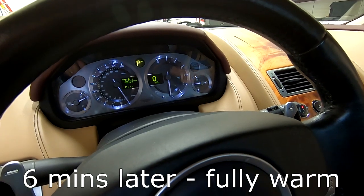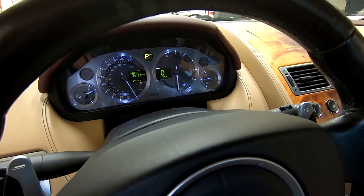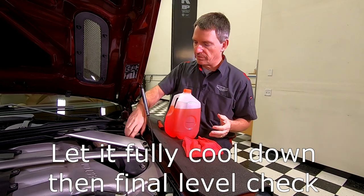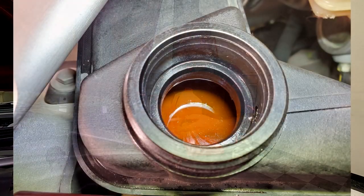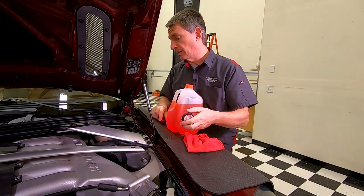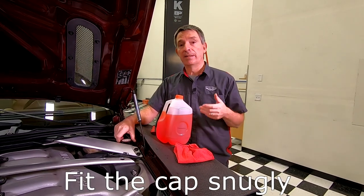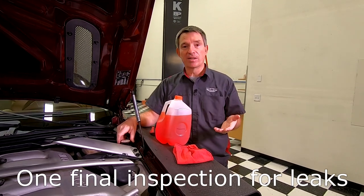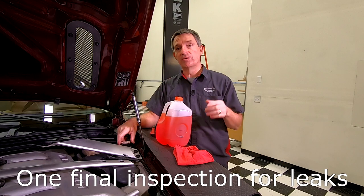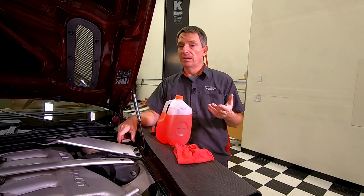It's been about six minutes since we started the car up - you can see we're up to full normal temperature. So let's go ahead and pull the car into the shop and do a final check on the level after it cools down. We're back in the garage now - I've let the car completely cool back down. I'm going to open up the reservoir and do one final check to make sure that the coolant is about an inch below the upper lip at its maximum fill, and it is. If yours is down a little bit because it's burped out a little air, just go ahead and top it up with a little bit more coolant, then make the cap snug. I'd also recommend getting underneath the car to make sure you have no drips, and checking that the drain plug is dry as a bone with no leaks. If everything is all nice and dry, you can go ahead and get the undertray put back on and wrap up the project.